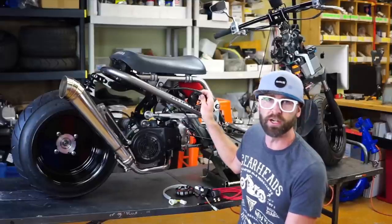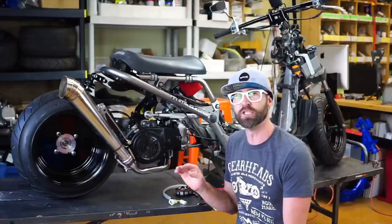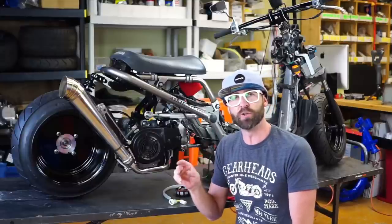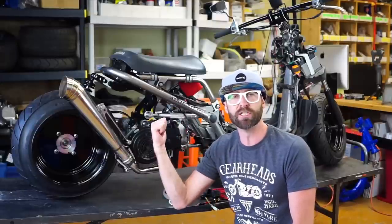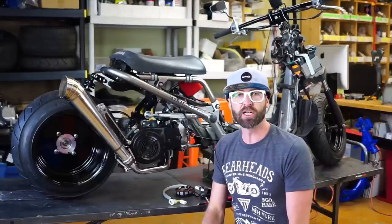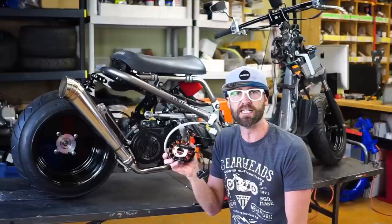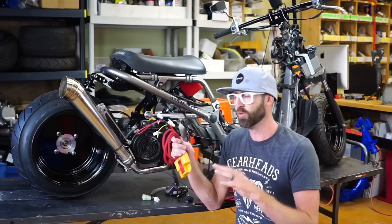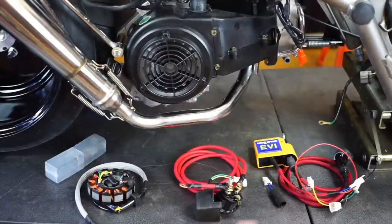You use your original Honda Ruckus wiring harness and your original fuel pump, which works all the way up to 232cc. There are a lot of benefits to using the stock fuel pump — you don't get that vacuum-style fuel pump cranking and never starting until the gas reaches the carburetor. We're also using the stock rectifier-regulator from Honda to run our stator, which plugs directly into the original Honda Ruckus harness. Let me show you what's included.